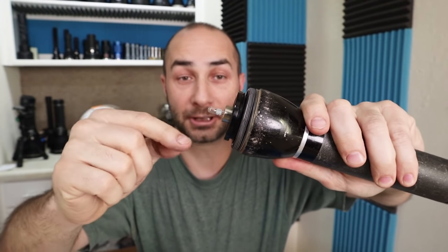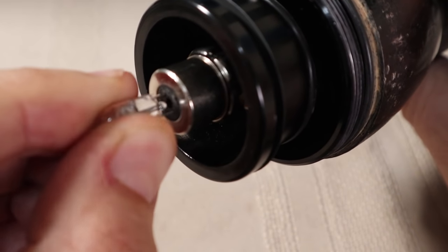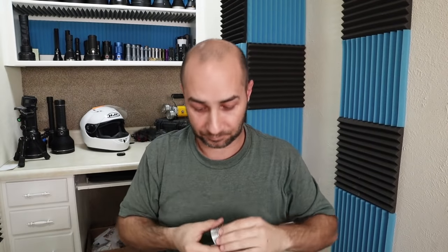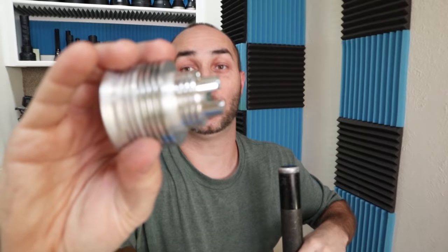Now, this bit can be tricky unless you watch this video. The Magcharger has a bipin bulb in it also, but we're not going to take that housing part out of this one. But watch this. Here's the bipin bulb. I can spin this around and around, okay? And that's important because you may have to line up these pins to get it to sit right, okay? If this has pins in it, in the bottom, just like your bipin bulb, and there's those posts in there, those brass buttons where the old reflector used to push the bulb up and down for focus. This has slots that those have to go on.